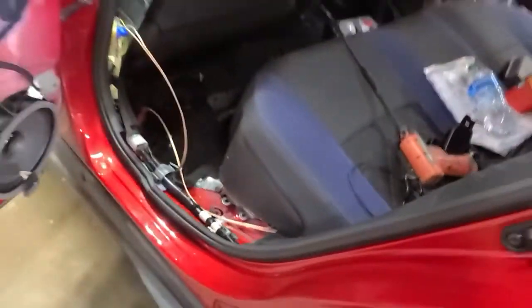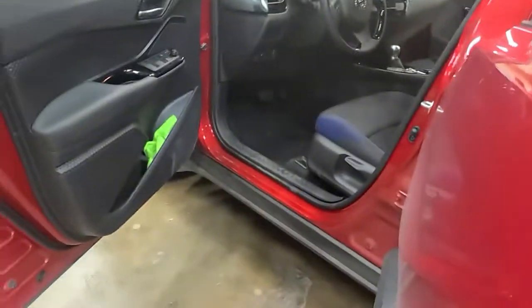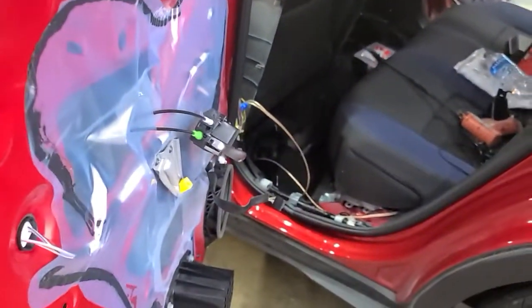On the driver's side, the wires to hook into are black and yellow. The same thing applies — you look for the ones that are twisted; see how they're twisted there. I took the door panel off to verify the wires are black and yellow. However, the harness that comes down has a lot of black wires, so it's kind of hard to figure out what's what if you don't take the door panel off, unless you're looking for those twisted wires.